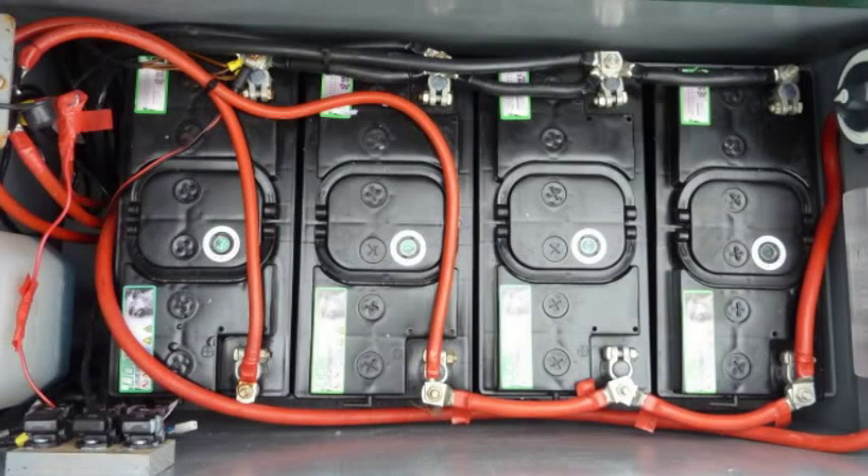When we have a battery, its best bang for the buck — the most longevity you'd get without babying it excessively — is to figure out the boat's amp-hour consumption over a 24-hour period if you're cruising, and then say, okay, that's how many amp hours I need, and I need at least triple that. For long-term cruising, I would say you need a battery bank measured in amp hours probably four times your daily amp-hour consumption. This is because we can never fully charge the batteries unless we have a generator and a battery charger and are willing to listen to the generator charge it, given the amount of time it takes.